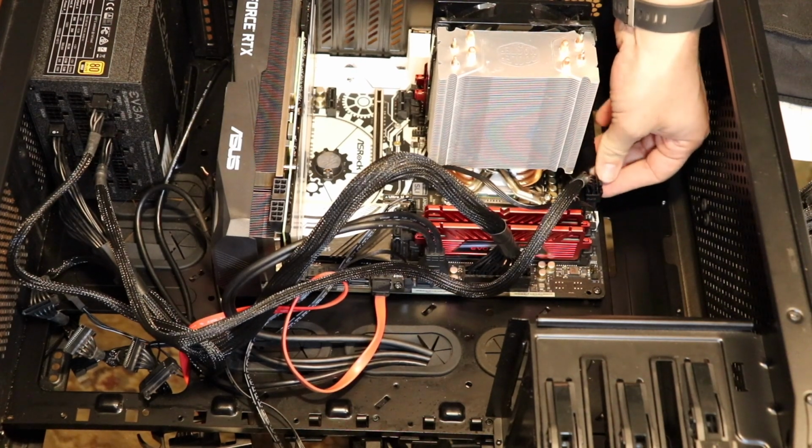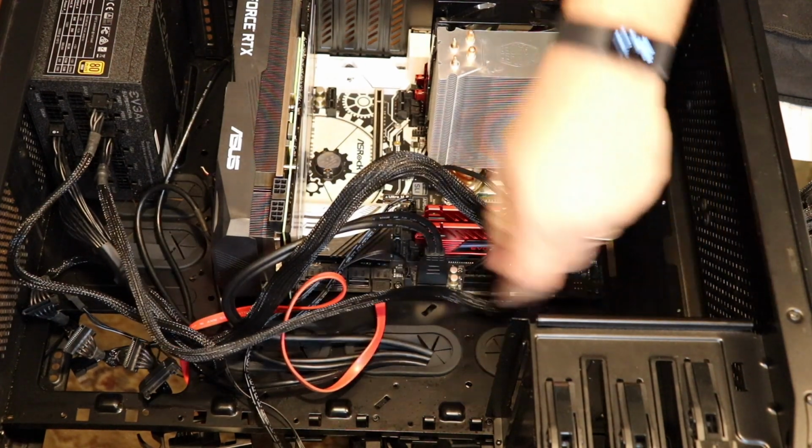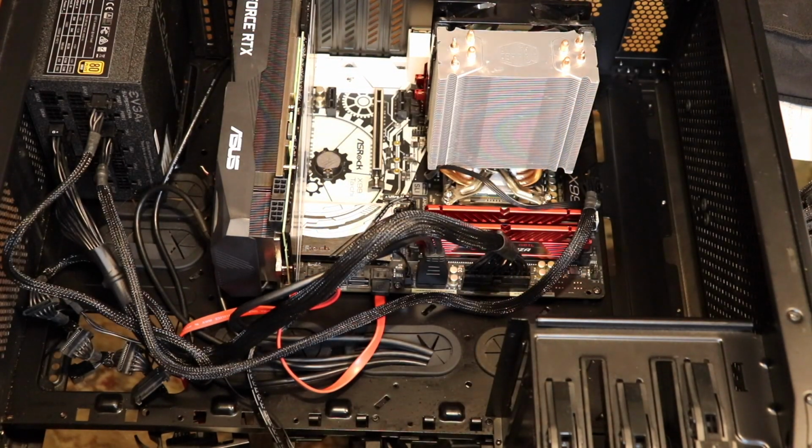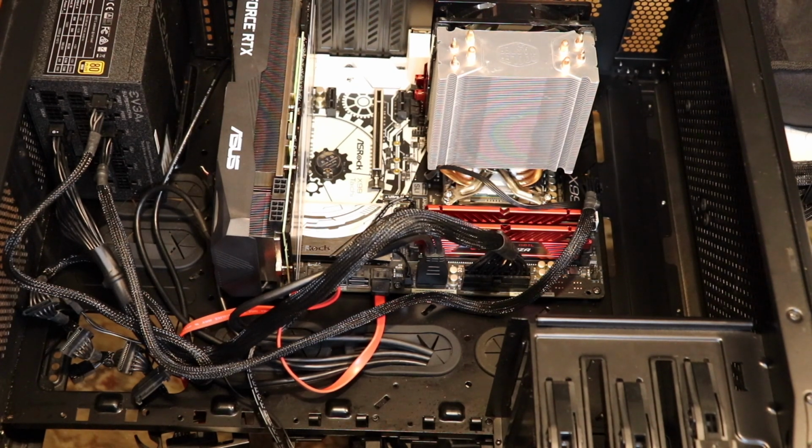If you don't have power, you're going to see the same thing that I was telling you before. The computer will come on, the fans will spin, and the computer will just shut right off again. That's called posting. Usually, if you haven't modified your computer, when you turn it on, it'll go through a series of tests. Do I have enough power? Is all my RAM plugged in? All that kind of stuff. And then it'll beep when it's done with those tests.